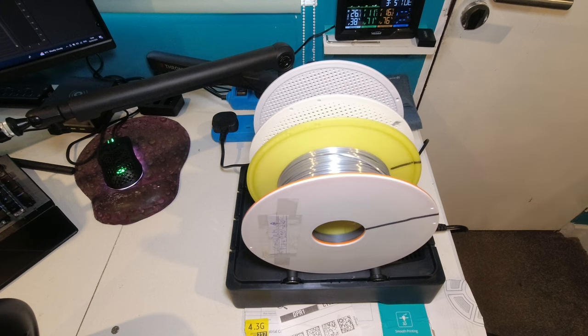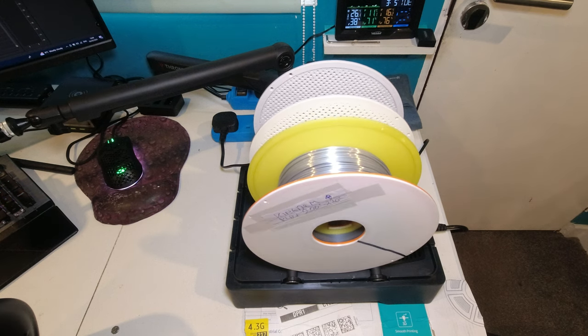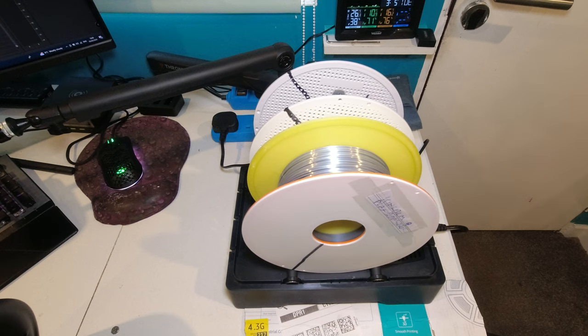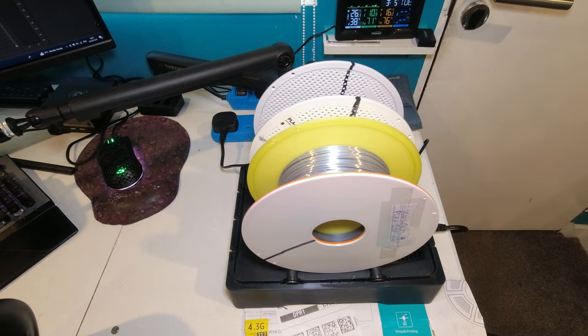We'll let it get another complete revolution. Speed this tiny bit up. Now you can see it's coming up now, the back reel, to where we started them both together. And the front reel is way behind, even though none of them are stuck this time. So as you saw there, it was definitely slipping. If I say the word sticking, what I really mean is slipping. The reel sticks in position, but the reason it's doing that is because the roller underneath is slipping. So it's always a slipping problem.